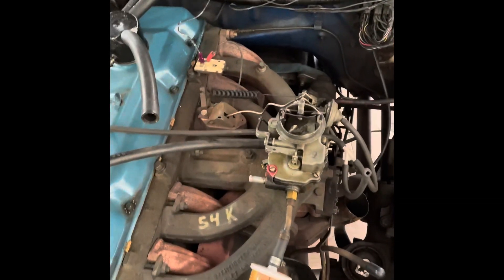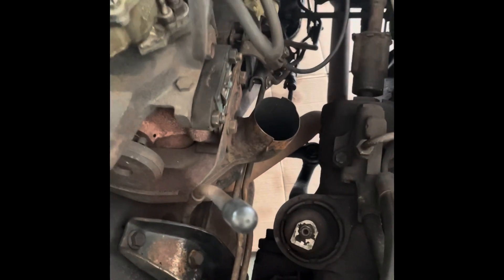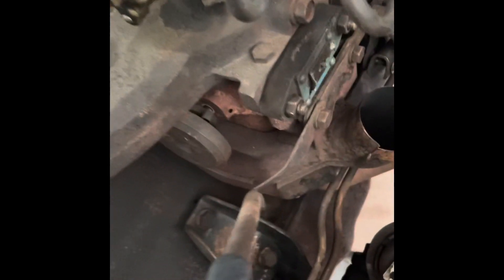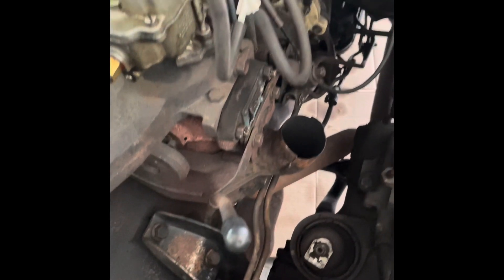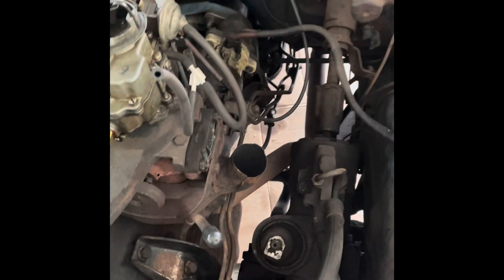This is pre-computer control, so there's nothing electrical that can magically make that happen. What they developed is a vacuum temperature-controlled system. In the air cleaner there's a device on top that looks like a little hat — there's a vacuum diaphragm in there that opens a flap inside. When vacuum pulls on it, it pulls up on that flap, which causes it to draw air through a tube connected to what's called the stovepipe. It's basically sucking air from around the exhaust — not the exhaust gas itself. That's the role of the EGR, which in my case is blocked off. You want that hot air when the engine is cold, so that vacuum pulls the damper open.